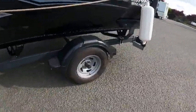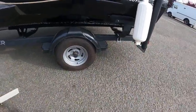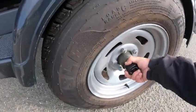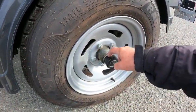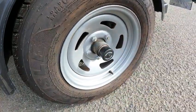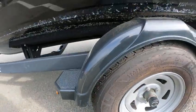I know people ask why go through all the trailer — well, you got to do it; some people haven't seen it. These have buddy bearings, so every time you go on a trip maybe you want to check them, give it a couple pumps. A lot of people make a big mistake on these: you take this off, there's a spring around here with the greaser in it. You pump until you see that inner spring just move and quit — don't pump it until the spring goes all the way out, because then you're going to blow a seal. Disc brakes, these springs.